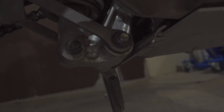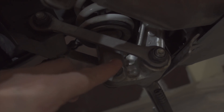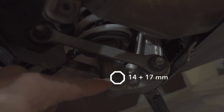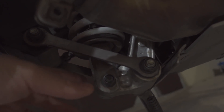Under the bike we can see the suspension linkage coming in here. The actual suspension comes down and is fastened here — there's a 14 millimeter socket there and a 17 on the other side. You have the same up a bit.